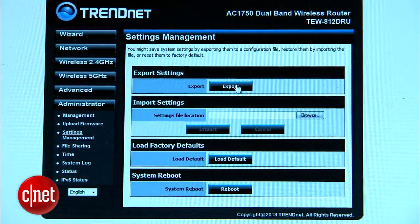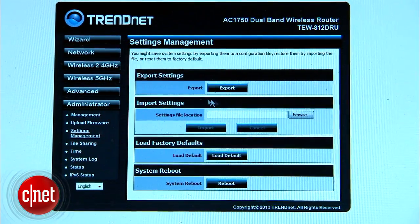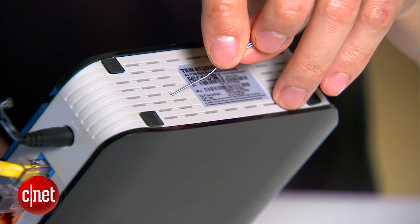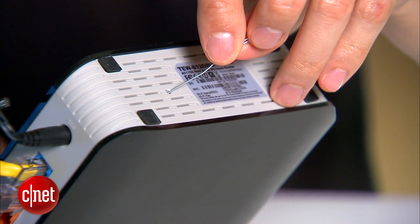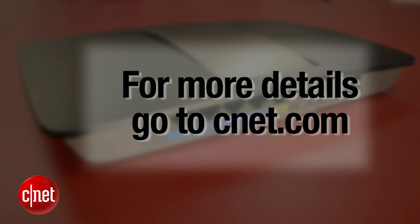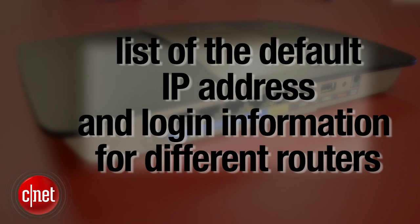The reason I really encourage you to tinker away is because you can always reset the router to the default factory setting. You can also backup the existing setting and then restore it later. To reset to the default setting, you can use the web interface or use a small pin like this and press the reset button on the router — all of them have one. Just press it in for about 10 seconds and the router will go back to the default setting, which means you don't have to worry if something goes wrong. For more detailed information, check out the website where you can also find a list of default IP addresses and default login information from most vendors on the market.